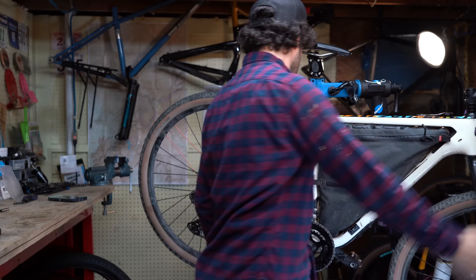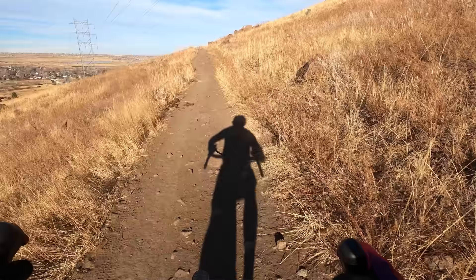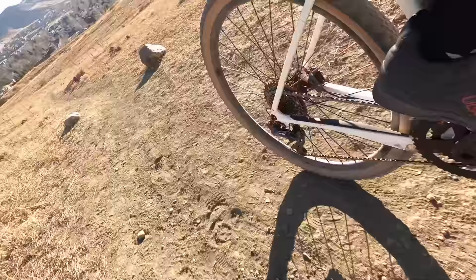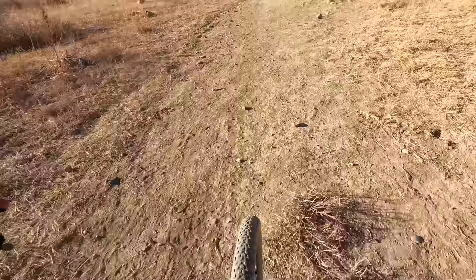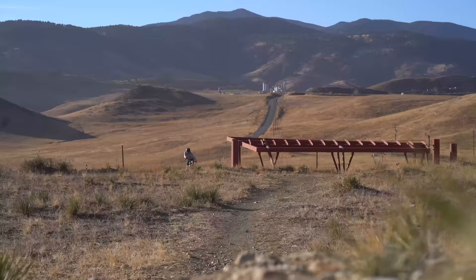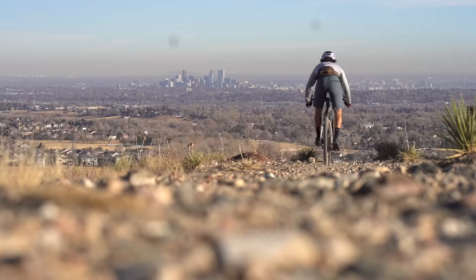It shifts, which is obviously an important part on the stand, but we're going to take it out on a ride and see. If I find that some cogs are skipping, then the cassette is trash and I'll replace it. I just got back from an hour ride on some local trails and to my surprise it shifted pretty well — no skipping. It was a little sluggish in the middle gears, which was kind of expected, but I don't think I'm going to change this cassette out. The one thing I need to keep a closer eye on is making sure the middle cogs don't wear out the new chain prematurely, so I'm going to continue checking chain wear pretty often.